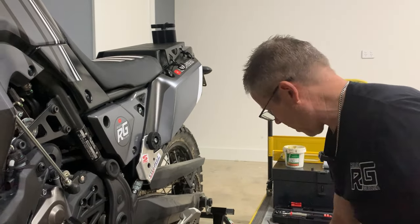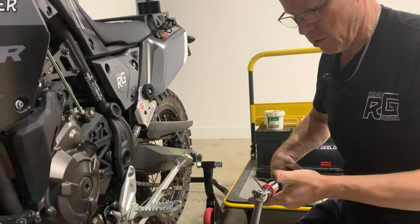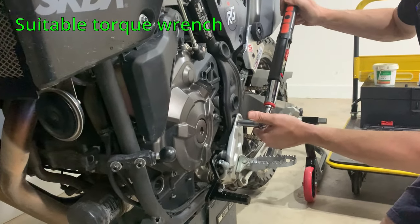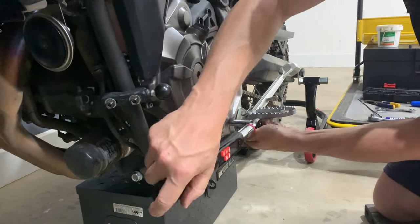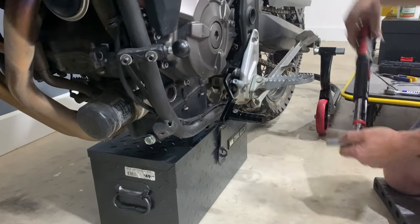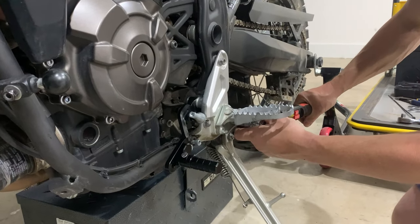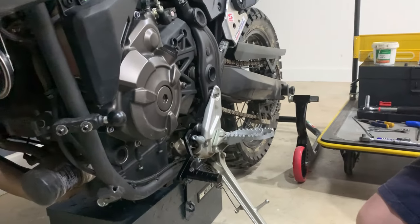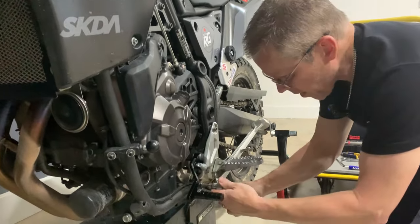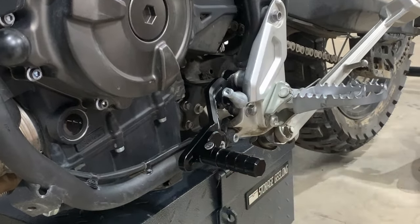Because I'm doing a video and I'm a bit pedantic, I did a bit of research — it needs to be 23 newton metres. So we've got the torque wrench. It gets within 20% range and starts bleeping, then you get to the right torque and it gives a constant bleep as opposed to an intermittent one. Those are correct. Let's go back to the 6mm socket for the Allen bolts — run these in.